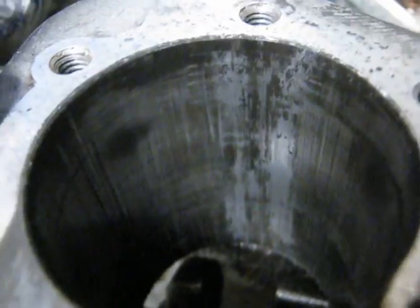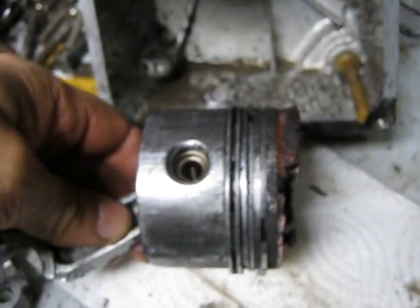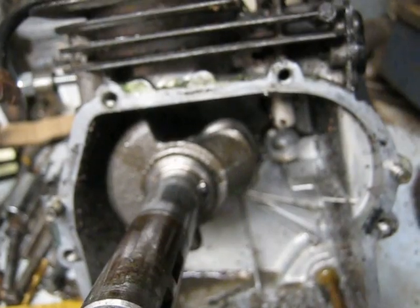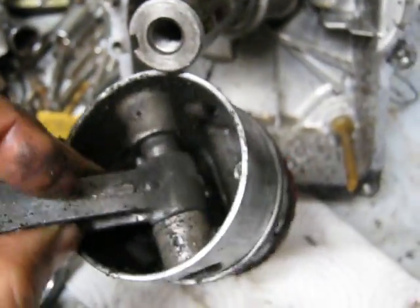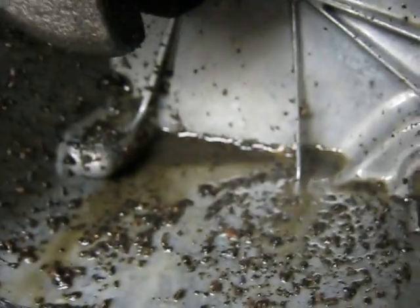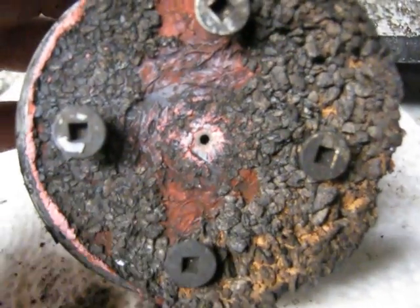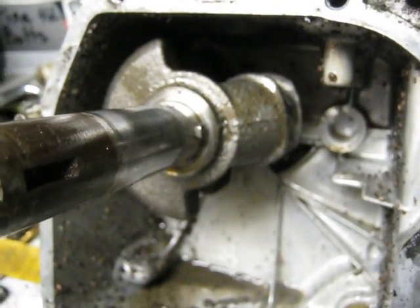I'm pretty sure I can get it running again. That's my intention — I keep doing these piston crown experiments. I got in too big a hurry trying to fight the sunlight to make a video and forgot to add oil. Unfortunately it was on one that decided to keep running even with that sixteenth inch hole in the center of the piston. In previous times I was running a one-eighth or three-sixteenth inch hole, which is huge compared to that. As you can see, all kinds of cork blown around in the crankcase — must have worked kind of like a rocket; the high pressure blew it right through the hole. Anyway, I'll stick with blocks of wood and other things from now on. If I have to sacrifice this engine, oh well — these things happen.